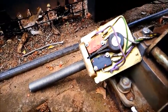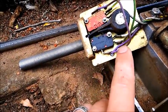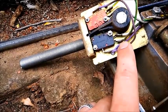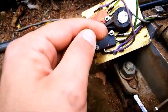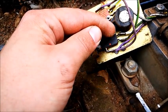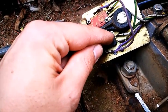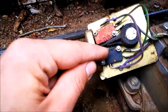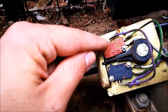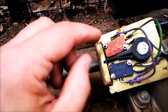Testing between these two points: when switching, it lets 20 volt DC through. On the other side there is 4 volt DC which goes away when you switch. This is normally open on this side and normally closed on this side. On the normally closed one, when you switch it over, I do get 21 volts going through.